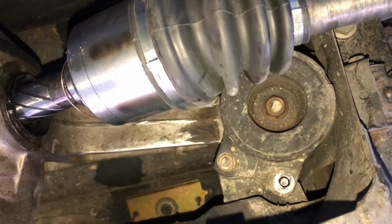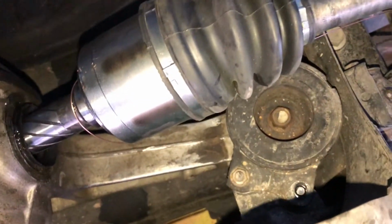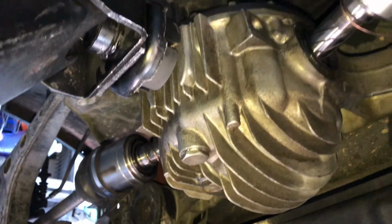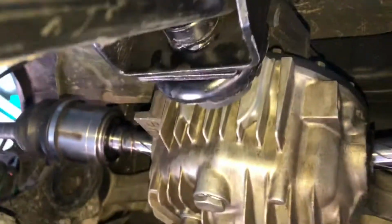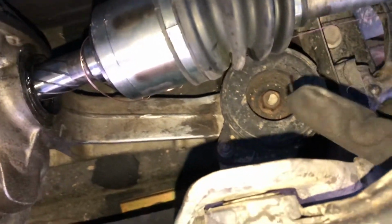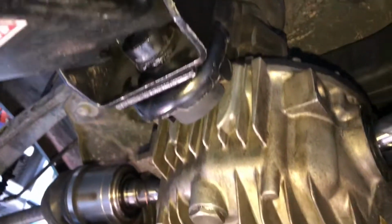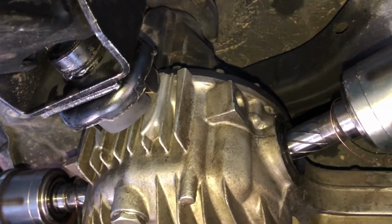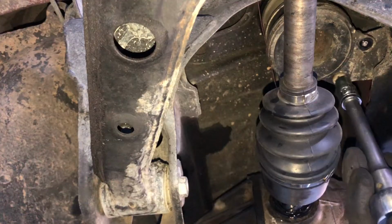So now I'm going to loosen these bolts here. First, I'll get the 412s. As you can see, I have the jack sitting right up underneath the trans, and as it starts to lower, I can actuate the jack to grab it. But due to the solid mount of the poly bushings I have in here, if I put any pressure on the bottom of this thing, it starts to lift the car up. So that about right there is all I get.